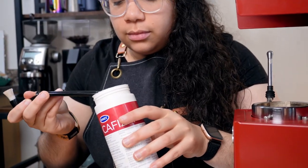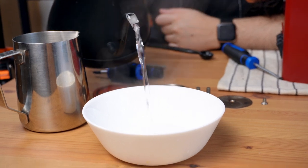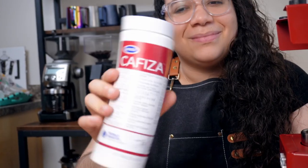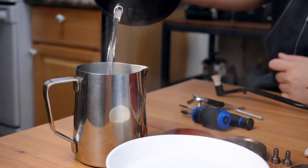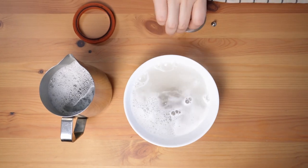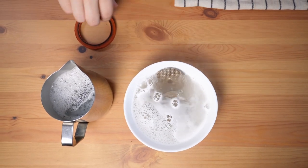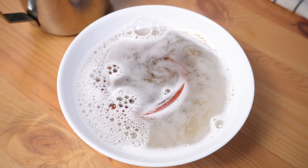I'll use this bowl with Cafiza solution to clean the parts. I always like to use hot water for this. The Cafiza powder eliminates coffee residue and oils. Let's also prepare a little extra solution to remove any buildup under the gasket with a stiff brush. Dump it all in there, so while you scrub and clean the insides of the machine, the solution will do its job removing any buildup in the separate parts.